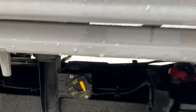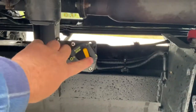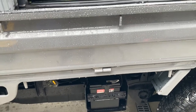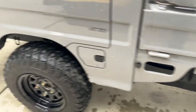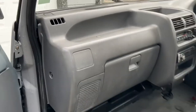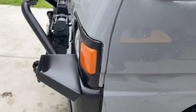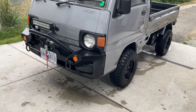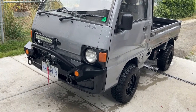There's also an isolator switch here — I can isolate the front battery if I want to run just the main battery. The vans have the battery located under the passenger seat, so I put a battery in there and they're tied together, giving me a little more amperage for the winch. Inside I put some Blaupunkt speakers and a little Pioneer stereo — nothing too special. All in all, great little truck. That's the end of this project — comments and thoughts below, any questions on the stuff I've done please let me know, I'll get back to you. Thanks a lot for watching.